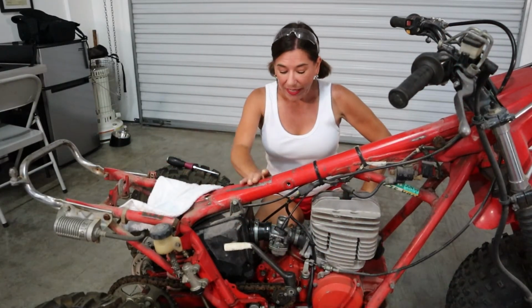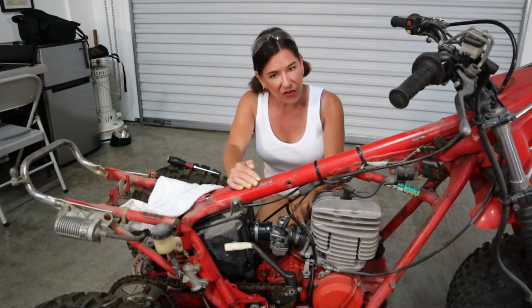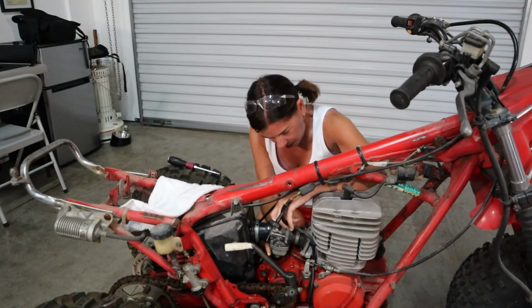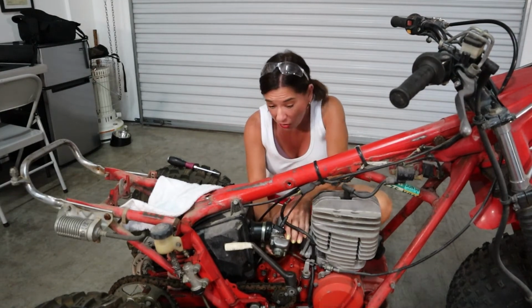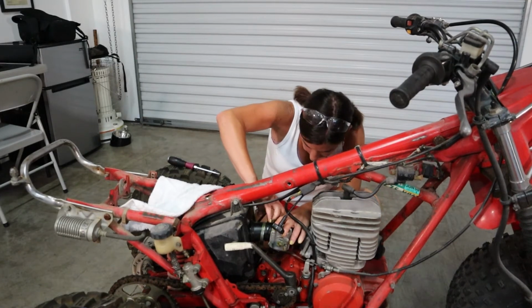Okay, so the clamp is loosed, it's pushed back. This clamp is pushed back as well. Now this rubber is soft, this rubber is hard. So what we're gonna do is pull up on the top here and then push it back. You don't wanna use a hook tool on the soft. You shouldn't anyway. Okay, I see the lip coming through.